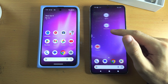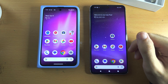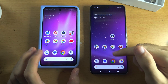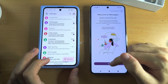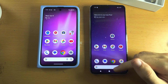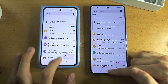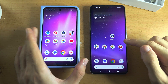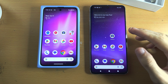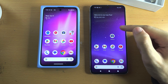On the home screen, if your old phone was Android, the wallpaper will be transferred. You can verify the transfer by checking your messages — all messages should have come over. Check your accounts to confirm they've all moved over as well. Before factory resetting your old phone, make sure all apps are on your new phone and that you're signed in to them.